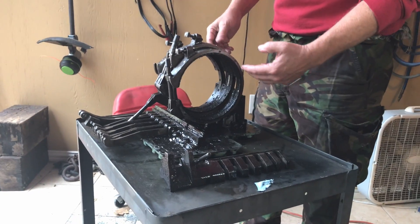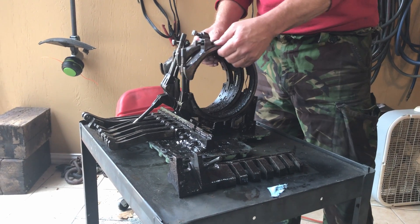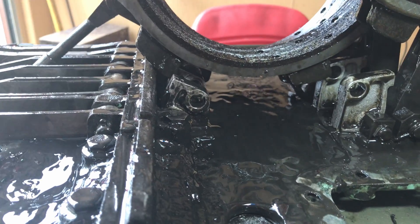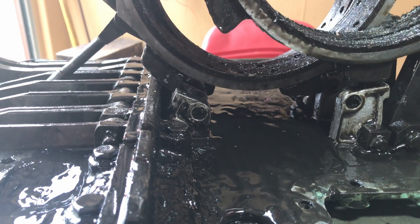We will take these off. When you are disassembling something like this, be very careful as you lift up — there's a spring in each one of these called a steady spring. There are eight of them. They fit between this plate and the other plate right here, and they steady the band.